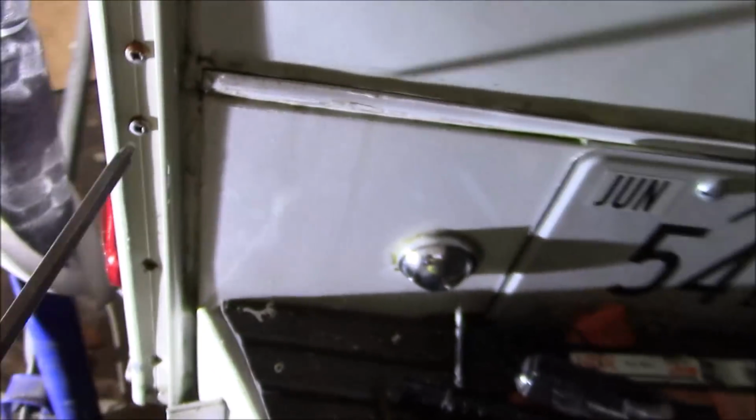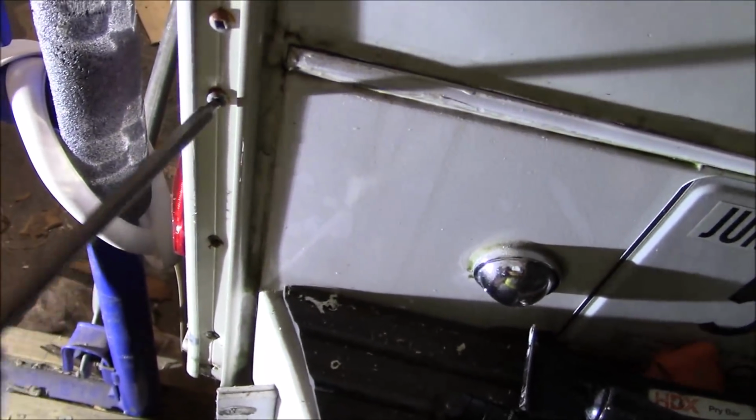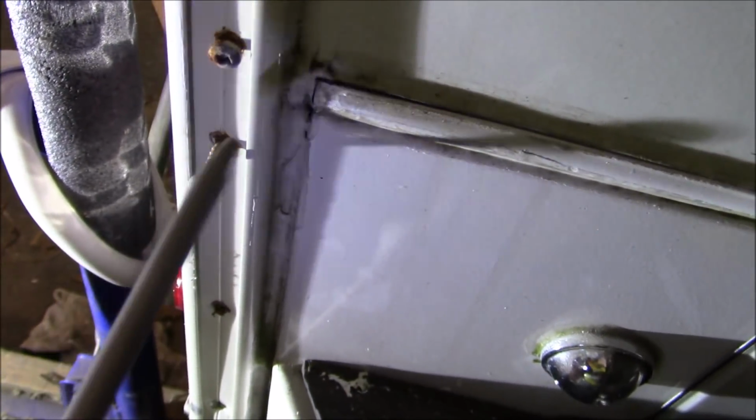Okay. I took this off. This is just a screw cap cover that goes on there, like this one is. They just literally pop right out. So a good indicator is how much rot we got in there, or damage, or moisture. Let me take these out. See the screws? Rusty. That tells me it got some issues going on in there. That one's spinning. Now look at this one here. That's still spinning. See how rusty they are?